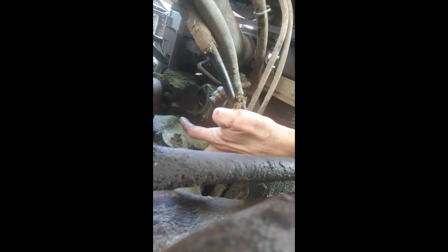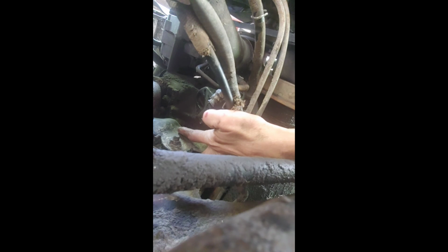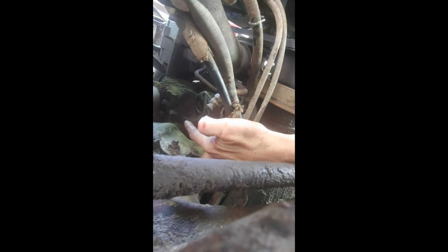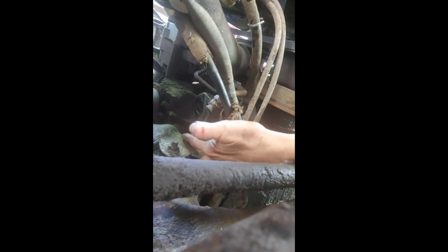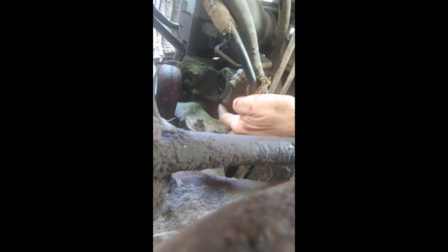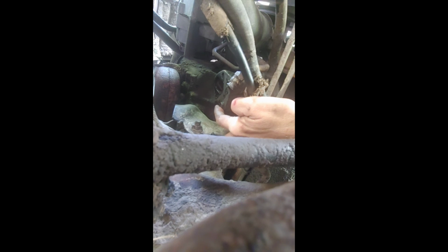But the hard part is getting this bolt over here, because all this is in the way. You can't do it with a wrench because there's no room to move it, and if you do it with a socket, it comes up against the side of the frame and can't get the damn thing out. So it's going to require one finger and a lot of patience to get that gasket to fit in there. Whee! And no, I'm not going to film it because it's in a spot where I couldn't really put the camera anyways. But we'll find out how well this works.